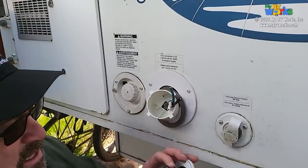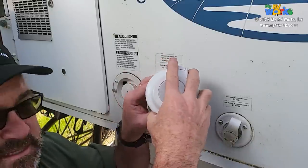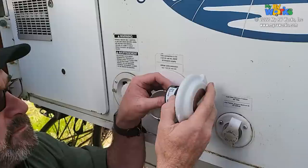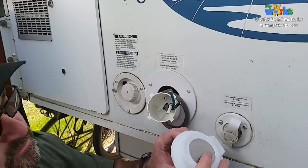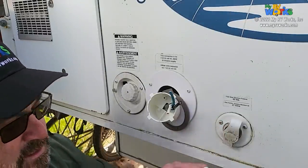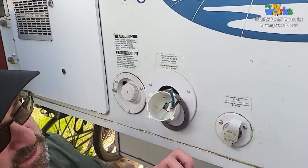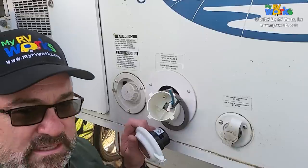So it's pretty straightforward. I'll tell you what, I'm going to save you guys some time. I'm just going to go ahead and make these splices. I don't think you need to watch me do that. It's pretty straightforward. Save yourself some bandwidth. And basically, I'm going to strip them back, put them in here. If you've watched my other videos on electrical, I'm a big fan of torquing things, but this thing does not have any torque limits on it. But it does have a gauge on the back to tell you how far you want to skin it. But I do not see anything where it talks about torquing. So I'm going to do about 30 inch pounds.